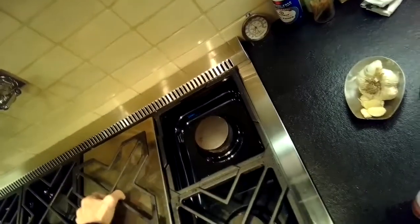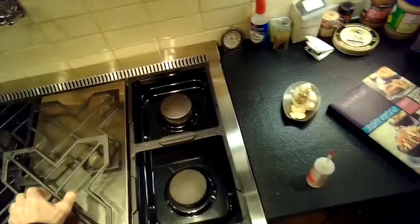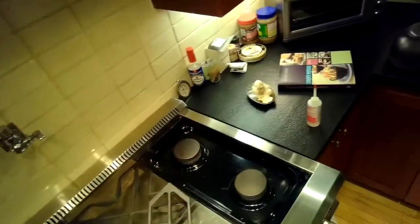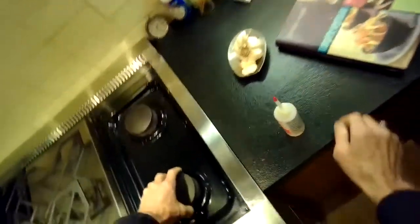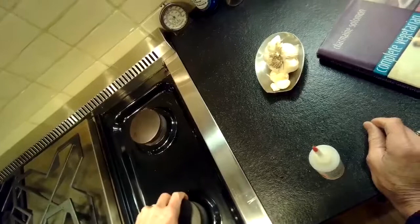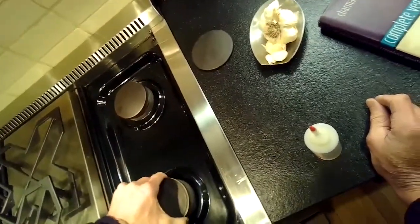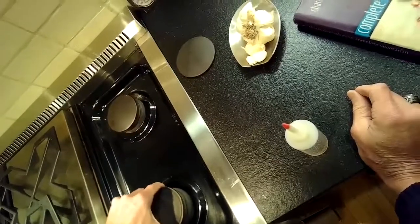The reason we were trying to remove the venturi nut in the first place was that the igniter would click on and just stay on. So I was just trying to replace the igniter, which entails removing the venturi nut, but it ended up not coming out, and it ended up severing the gas line down at the bottom of the burner.